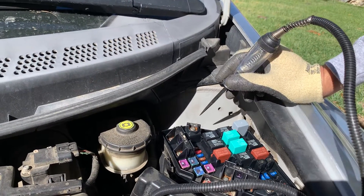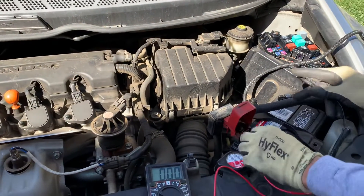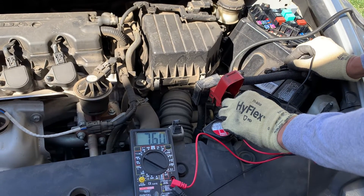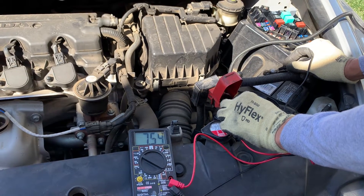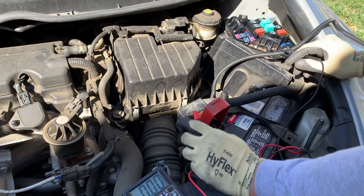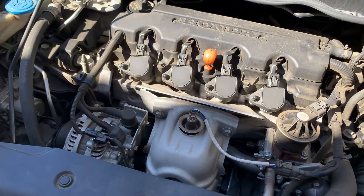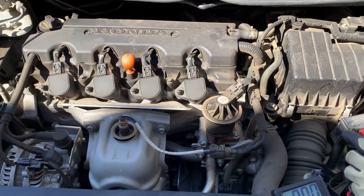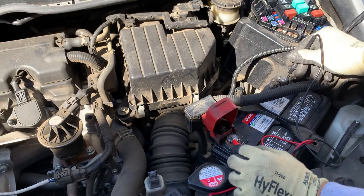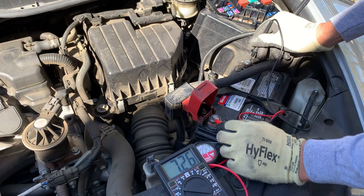Check one more time the battery — I'm pretty sure it's drained already. Look at that, it's about 7.6. The car is about to turn off, and that's because the alternator is not doing its job. As I mentioned, most likely has to replace the alternator. You can see how it's jerky now because we have no juice from the battery — it didn't charge. 7.3 and it's still dropping — better turn that off.